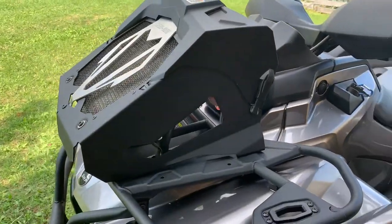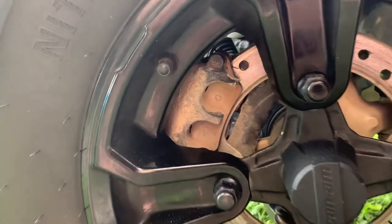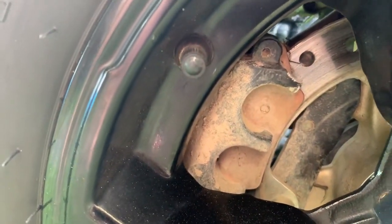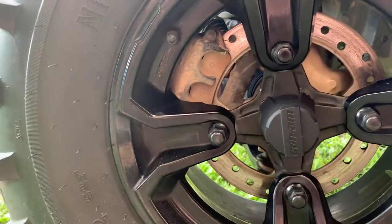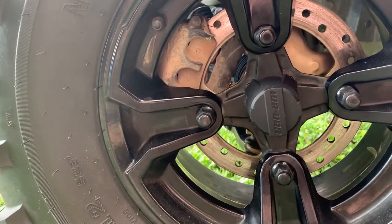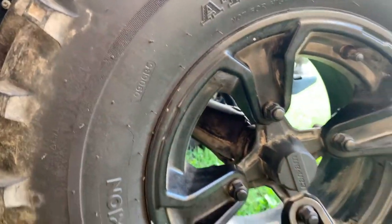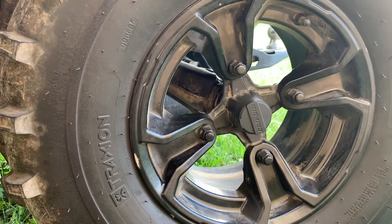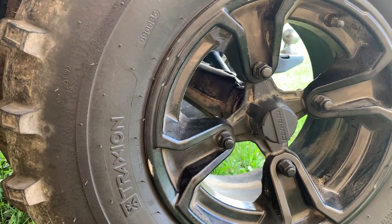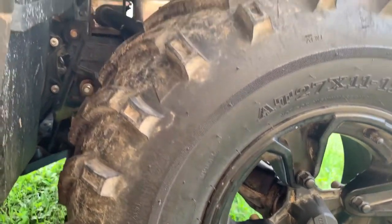The second challenge would be the factory brake pads. I had around 850 kilometers on my machine and the brake pads were completely done — in fact I had to replace my left caliper as the rings started to wear on the rotor. If you have this machine or any Can-Am product, make sure you're checking your brake pads regularly because the factory ones are very soft. I went with an aftermarket brand that are much harder and should last a lot longer.